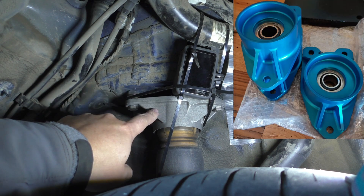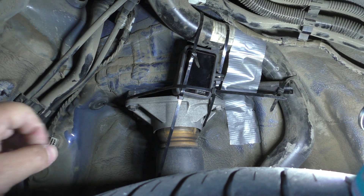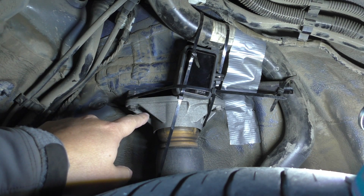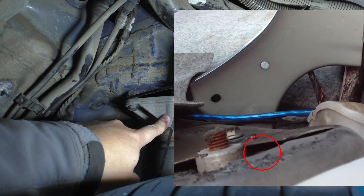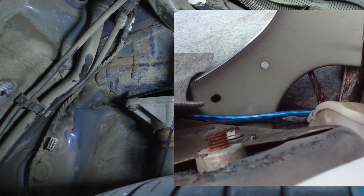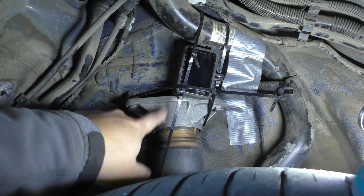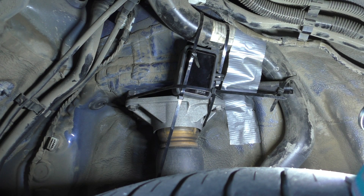I was asking him about the rear solid spherical bearing shock mounts that he makes, both for the BMWs as well as the Volvo. I think he has an S60R. He replied by sending me a video he took where he had a similar setup on his Volvo, where he filmed the top of the shock shaft in the shock mount itself, and you could see it was just jittering up and down constantly. Every time it moves up and down relative to the main body of the shock mount, that is travel where the damper is not actually moving — so your damper is not actually acting like a damper. You're just getting additional spring rate from whatever flex is in the material that the shock mounts to.